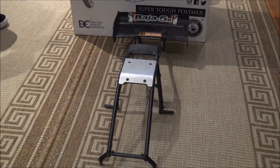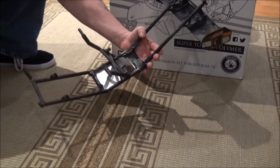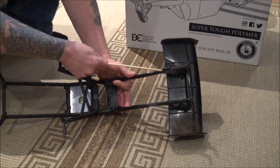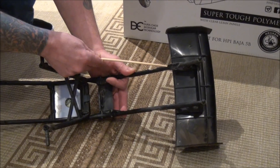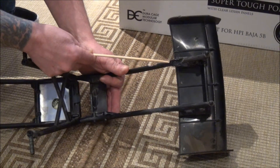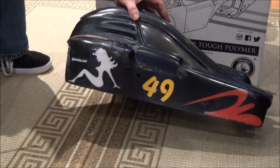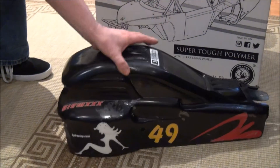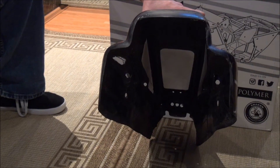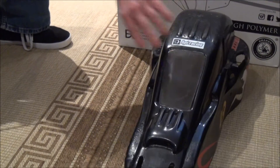I had my dominator pipe on the back of the original Baja with the cage on it, and when I was taking it apart I noticed it melted right here — that was from the pipe touching the plastic. It almost cut it in half. So I abandoned the dominator pipe theme and went for a different exhaust altogether. That also meant my battered 49er shell, which had an open back designed for the dominator pipe, was no longer of any use to me, so I had to abandon that shell as well.